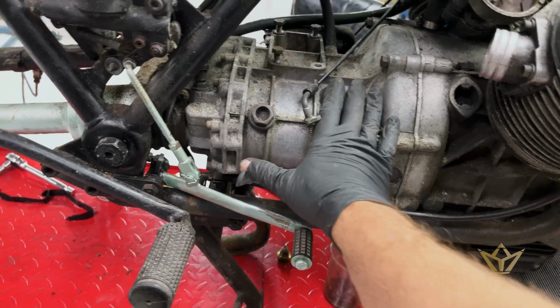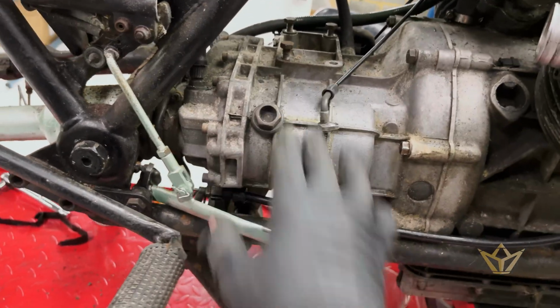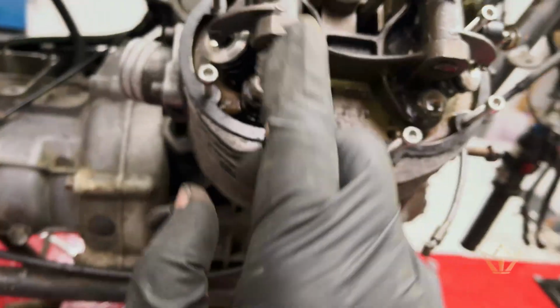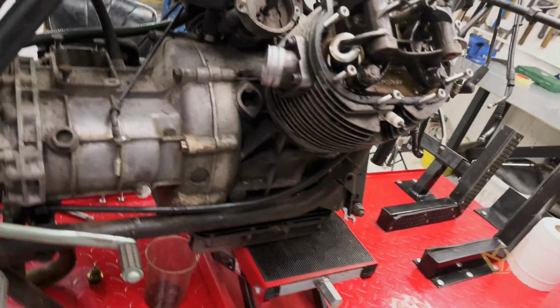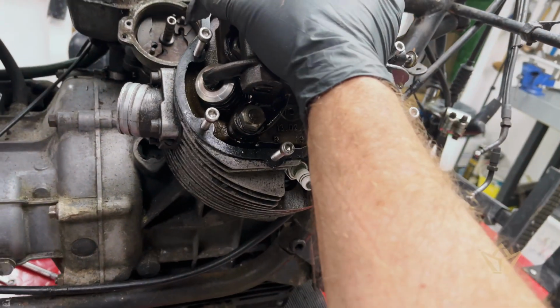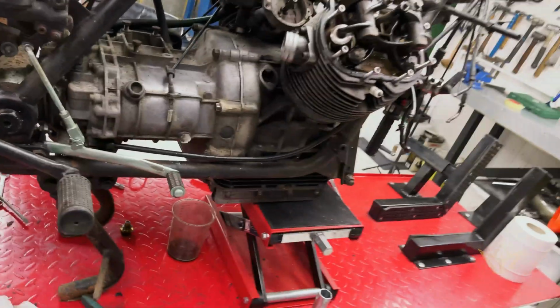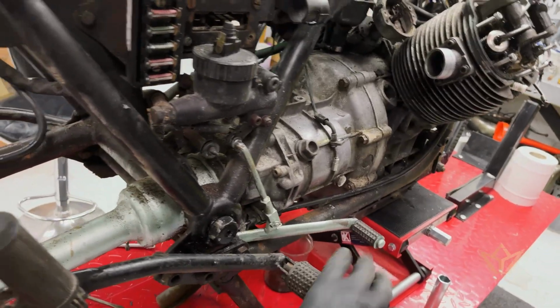We want to find how to get this engine, these bolts off. Then I can take the engine out. We can start to see where the leaks are from. We can take the heads off, let's do the valves, get them up to spec, check for any bore scoring, any wear, because they are down on compression by quite a bit, about half what they should be.